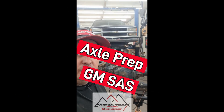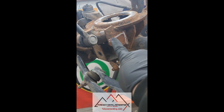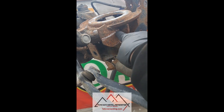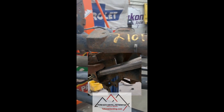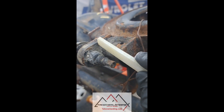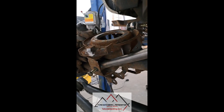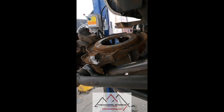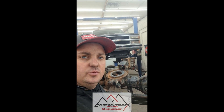Here are a couple of things you have to do every time you do a Tahoe Overlanding axle swap. First, right here on the passenger side, directly up from the track bar mounting point, you need to notch this out. The track bar will hit if you don't, because we get more droop than this axle ever saw. Second, this sway bar mounting point needs to be chopped off because the steering hits where that was. So you have to cut those two things before you do your Tahoe Overlanding axle swap.